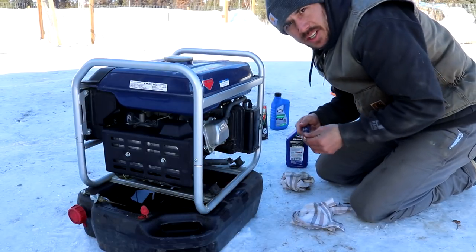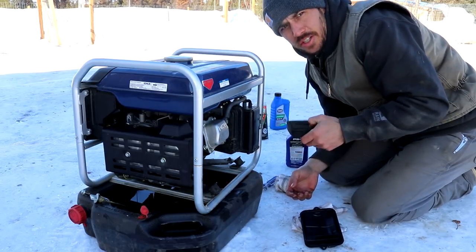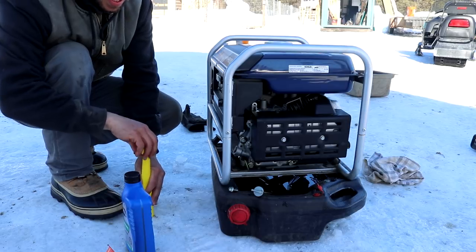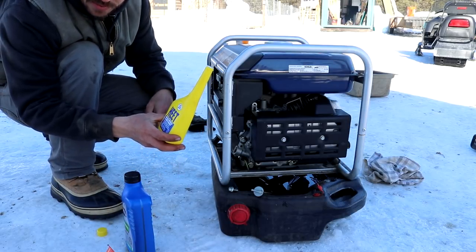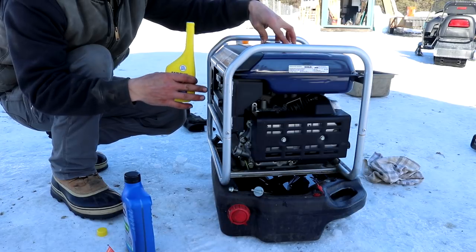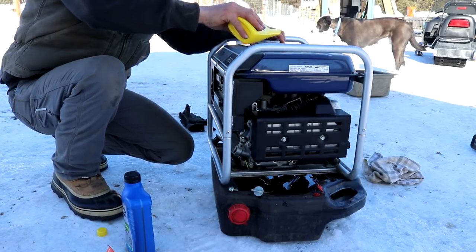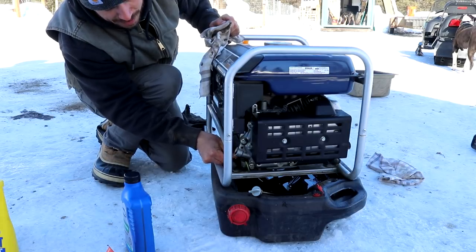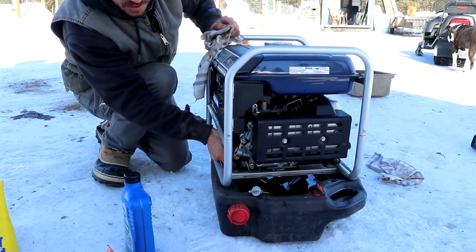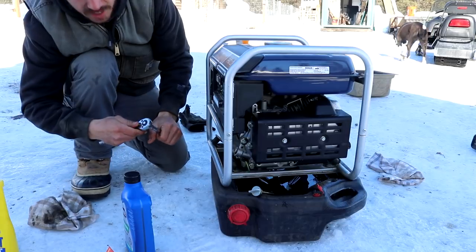While the oil is draining, I'll pull the air filter off and give it a look. This air filter is looking really good — it's not dirty at all. We usually run this thing inside our Shelter Logic where there's not a lot of dust, so I'm just going to stick it back in. I'm going to go ahead and add the Heat fuel additive — gas line antifreeze and water remover — to the gas. I usually put this in our gas cans, but I'm going to put a little bit extra in today since we're doing maintenance on everything. We've got all our oil drained out, putting the plug back in, then filling this up with 10W30 and checking the level to make sure we've got it full.